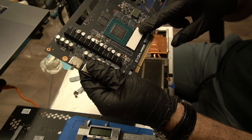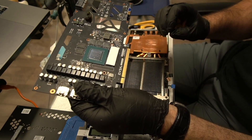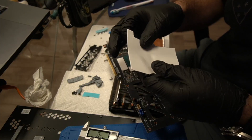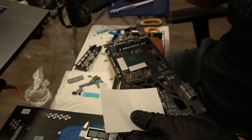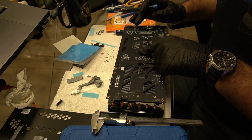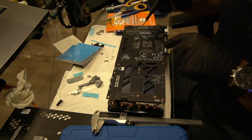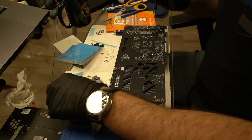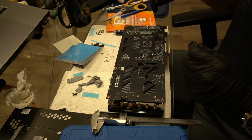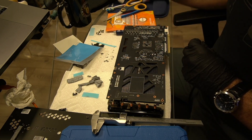What I do is put the pads right on the board. I think it's easier this way so you don't have to worry about getting the exact measurement. Remember, there is a plastic coating on the back of this — make sure you peel it off before you put it back together. When you're screwing these in, you don't want to go all the way on each one. You want to go in a little bit on each, then turn very gradually — almost like putting a tire on a car. You don't do one lug nut after the other. You want to spread it out. I do an X formation, just little by little until I get it nice and tight.